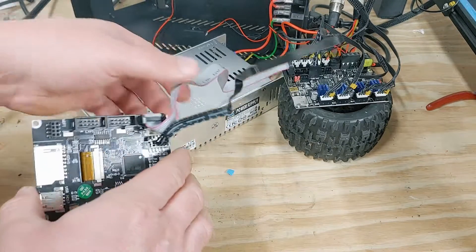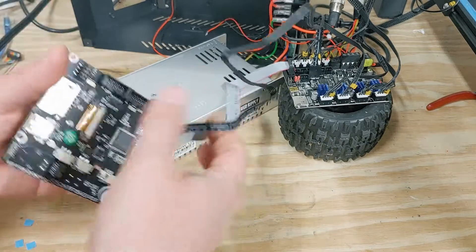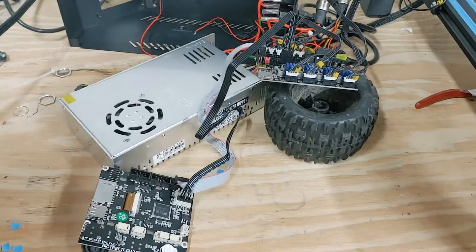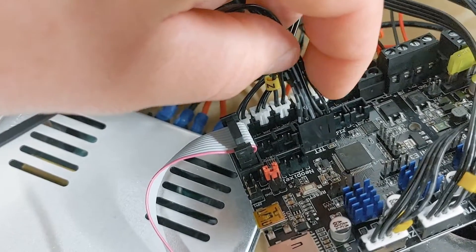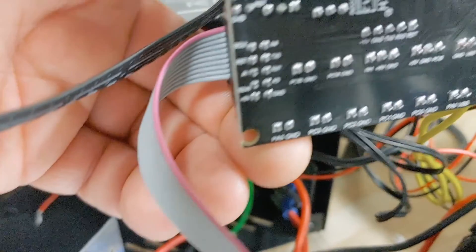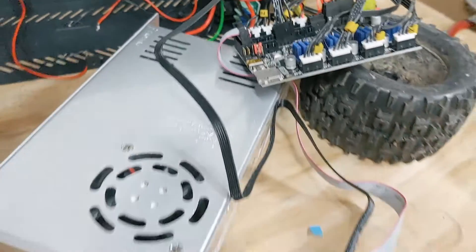The plug that was on the old board is this wire, and the new plug you'll have is this one, and it goes into RS232. It has one plug that is by itself. This plug goes in right there to TFT. This one little wire is by itself — it's got four-and-one plug and then one by itself. An easy way to know where that goes: you can look on the bottom of this particular board and it says RST down there, that is for reset. So you want this wire to go to the reset. You can look at it and flip it over and see that the reset is to the far right. If you plug it in backwards, it probably just won't come on.